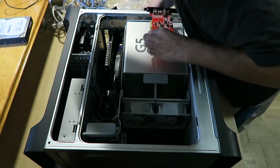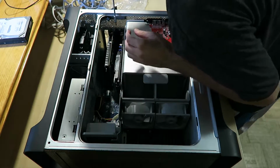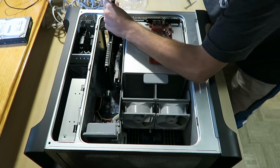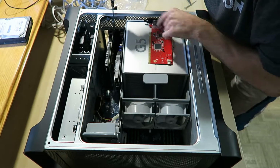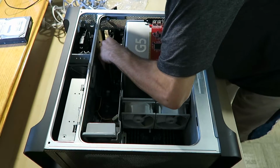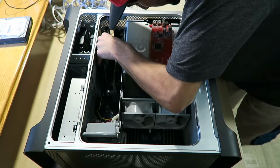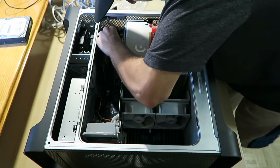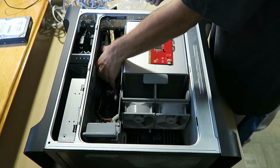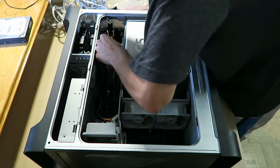The video card had to go on the very top because the top of that video card is sticking out near the bracket, and it won't allow the back of this to sit down to go into the slot. So I just gotta move this one up, interchange those spots. Just like that. Okie dokie. And this one goes in too before I lock everything up.